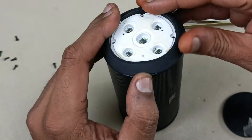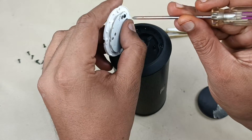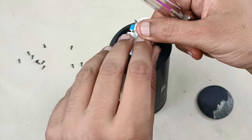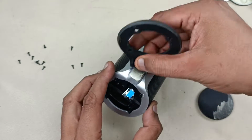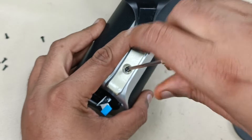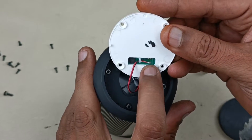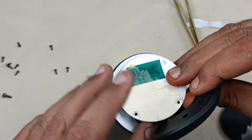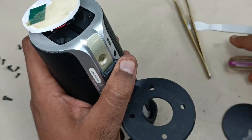Now this side — there are three screws here to remove the control board. Like this, and you can remove this by removing this flex cable; you can take out this control board. Now just remove this flap slightly — here one screw is there, you need to remove that. This is soldered in a very thin wire, so carefully you can remove like this. I am keeping this board close to the speaker so that the wire will not stretch. And remove this rubber; here one more screw is there, you have to remove that.